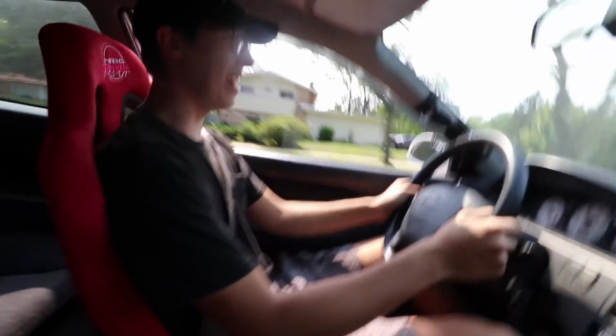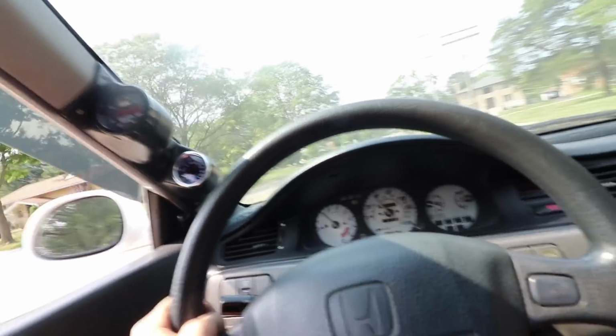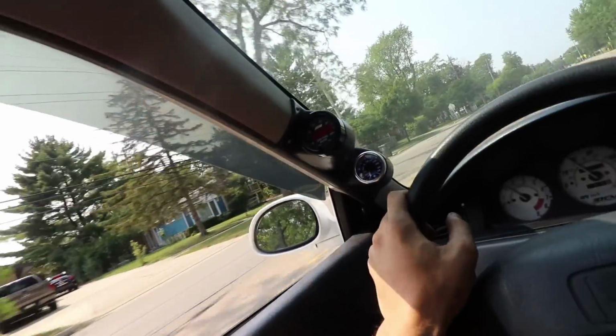Dude, look at us go! Alright, so far, oh, the speedometer does work! W! Speedometer works, AFRs are looking great, we're at like 13, 14 to 1 while cruising, which is perfectly safe for right now. I'm so excited, this motor is about to be so fun, boys.